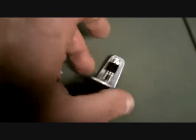This is a voltage regulator. No matter what you put through this thing, you can put up to, I think it's 35 volts, and it will trim it down to 5. Why would you need 5? Well, LEDs don't run on 12 volts from a car. They run on 2.5. Actually, I think the most you can put through them is 3.6, and then they go pop. Just a thing to have. And Dad made a cool heatsink for it.